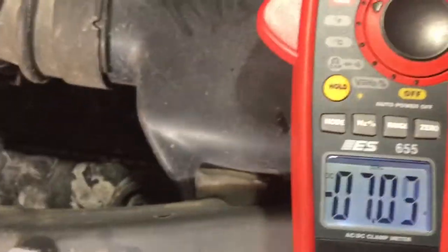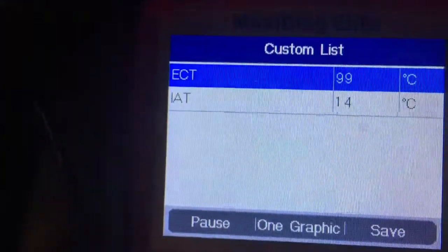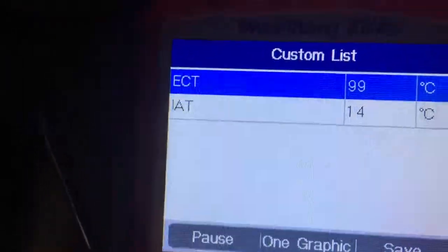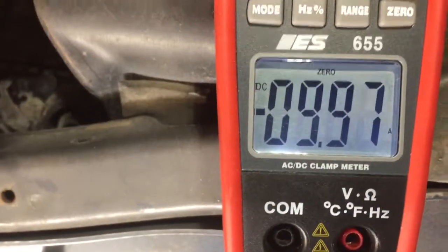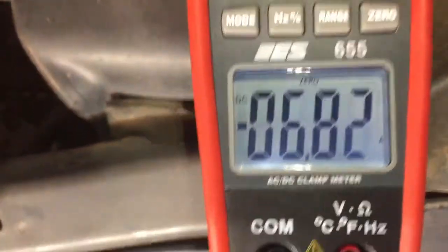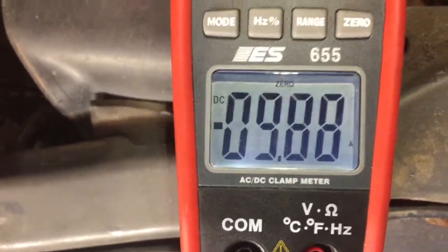That's just one coil operating on the fan if you will. We continue to crank the temperature up. At 101 degrees — running around 104 degrees there — there we go, almost 10 amps of current. I'll take you back: that's 103 degrees, back to 101, and you can hear the transition.